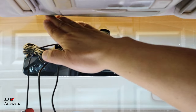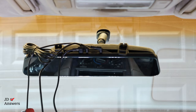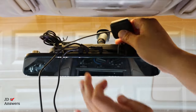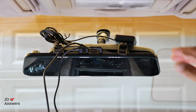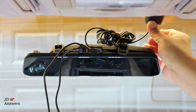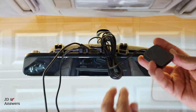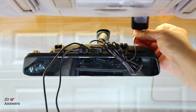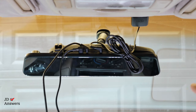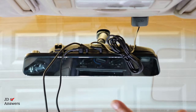The rear camera will go towards the driver's side, the power cable will be routed to the passenger side, and the GPS will be connected right here towards the passenger side. I'm going to install the GPS right here in the middle of the vehicle, or a little bit towards the right. I took off the protective covering of the adhesive and I'm simply going to install it right there. You can install this on the left or right side on the window seam, but I like it right here in the middle of the vehicle.